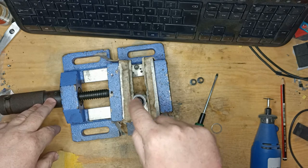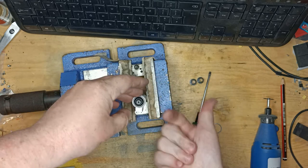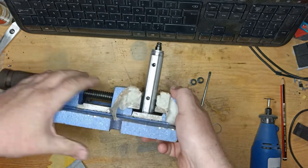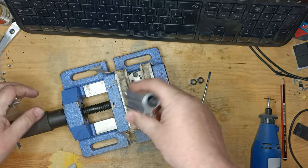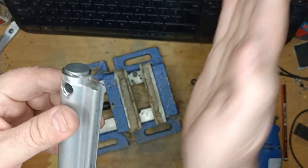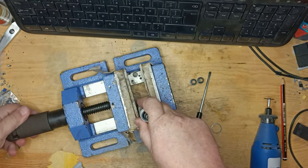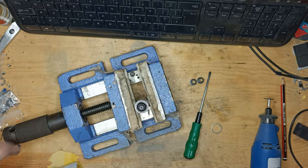What I'm going to do is hit this with a hammer. This plunger — how it's mounted in here — is obviously put in from the other side, when the bung goes in afterwards. Because of that, to get the bung out, we hit the top of this. I should point out that there are two indentations — the indentations themselves are sort of cramping it in. But it's aluminium, it'll flex out the way. Give that a swift beating with a hammer and that back end should pop out.